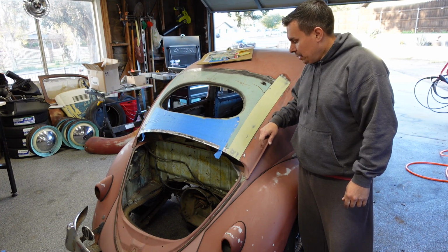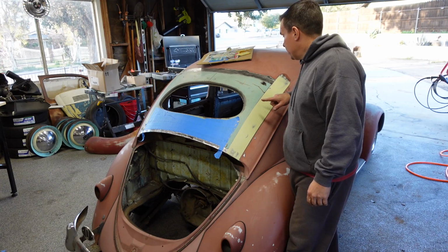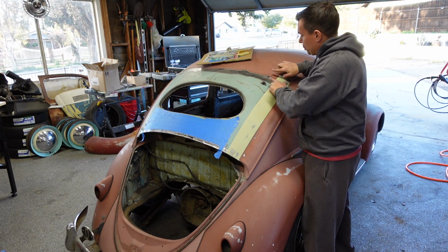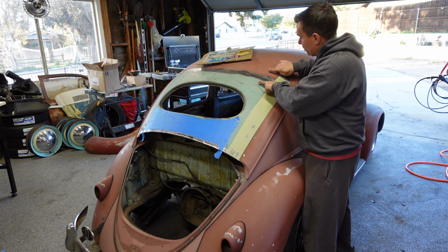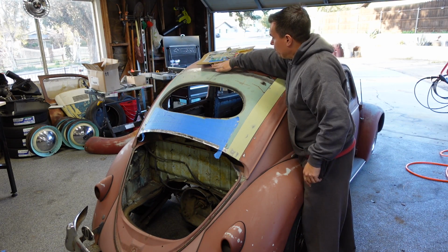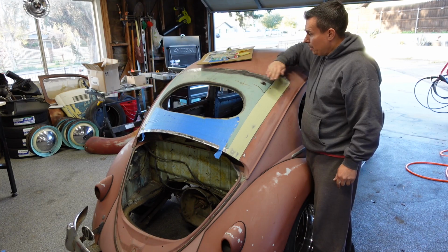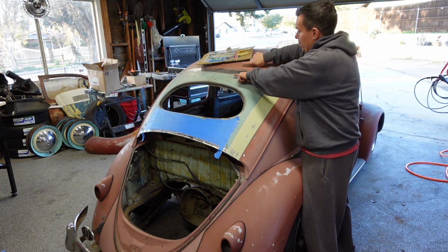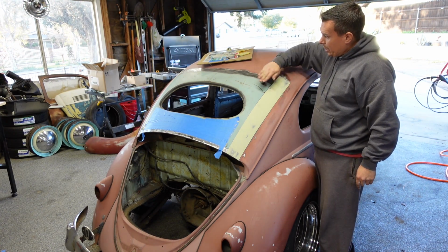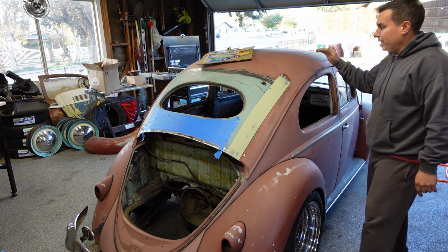Once this coat dries, I'm going to go across the bottom without even sanding this, and then we'll go across the top. Before we go across the top, I'm going to probably do the same thing I did around here, which is grind back the paint, probably between here and here, because that's my valley that I want to fill up with filler, and be able to sand and feather back so I can get a perfectly smooth working area, so that I can block 100% between that area and work the roof, and if you're looking at it from any angle, it'll be dead on.